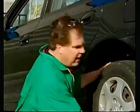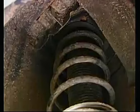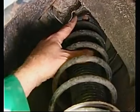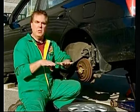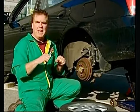They're great. Now, this week I want to talk about a very common suspension noise that you can get in the rear suspension of many cars that have McPherson struts on all four corners. That's when the upper mount on your McPherson strut wears out, and it can be a difficult thing to diagnose. The noise can be really bothersome. You tend to get the noise on rough pavement, say turning into a driveway or anything where one wheel hits ahead of the other, and you'll hear a banging or clunking or thumping sound in the rear suspension.